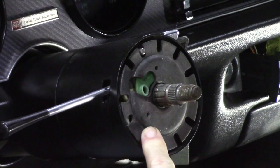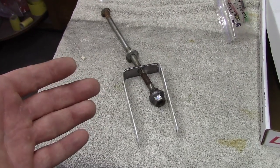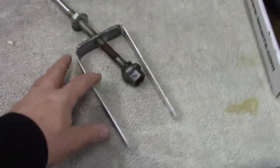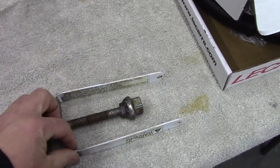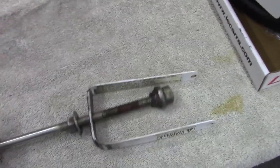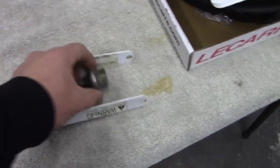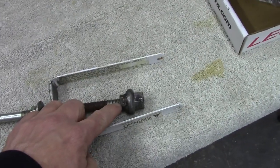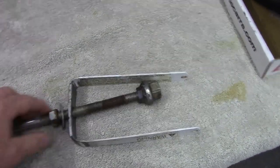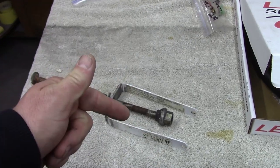They make a special tool you could spend money on to press this down, but let me show you what I came up with — a fine example of hillbilly ingenuity using junk and scrap. I used some scrap strap metal, a long carriage bolt with the right threads, and a nut that threads onto the steering wheel shaft. That nut got welded to another nut so the threads match, and I'll show you what the additional nut and washer are for. Basically, we're going to use this to push that locking plate down so we can use a pick to get the pin out.